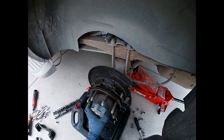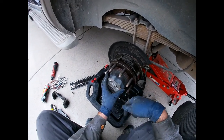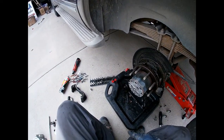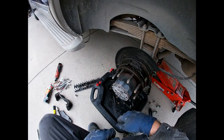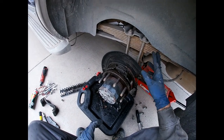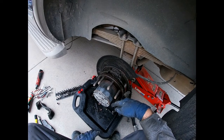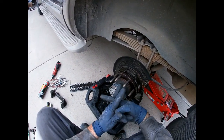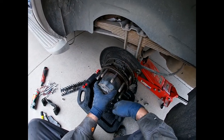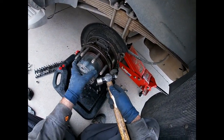On one of the Super Duties, Excursions, or heavier-duty vehicles, the axle will look a little different. The lighter-duty ones will usually have the lug nuts on this, but this is a full floating axle. What's nice is if you broke the axle shaft, you can actually just take these bolts out, slide the whole thing out, use a magnet to pull the broken piece out and slide a new one back in. There's a bearing in here and a bearing in there that helps support the weight, so the axle isn't bearing much of the weight versus a standard passenger car where the axle sticking out of the seal has the wheel putting force on it. On this one, the shaft just serves the purpose to spin.